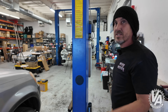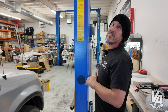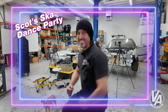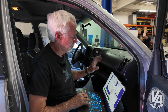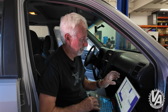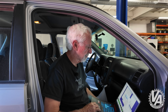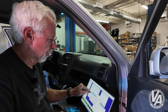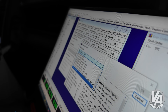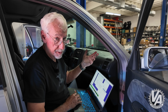Now we have our KPro CRV computer. Now you can back up and retrace your steps all day long without having to press a button — he still has to use the laptop to tell it to become a reverse lockout switch though. We are going to program the computer. This is a brand new Hondata KPro, it hasn't been programmed before. We need to give it a base program, so we're going to start off with an RSX base program — actually let's see if CRV is even a choice.